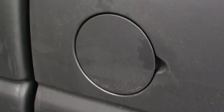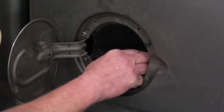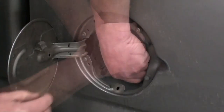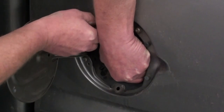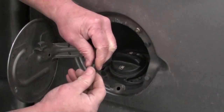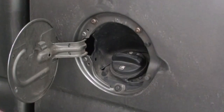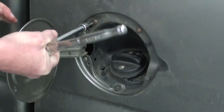Now I'm going to reattach the fuel filler neck — just pull it up in place, lining up there. You've got your two Torx head screws; get those started. Once you get those started, you've got your plastic rivet. Just pull the head up on the rivet a little bit, press the rivet down into the hole, press that plunger down — you've got it. Then all we've got to do is tighten the two screws.